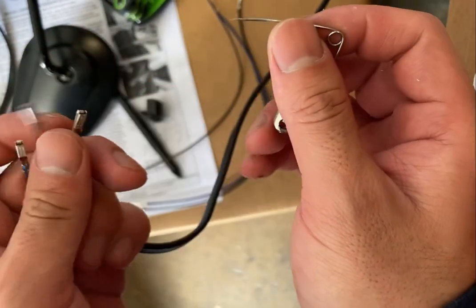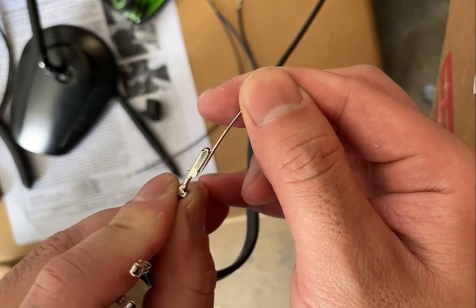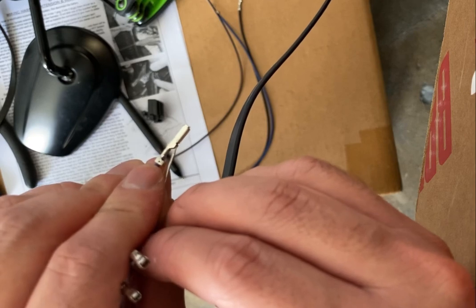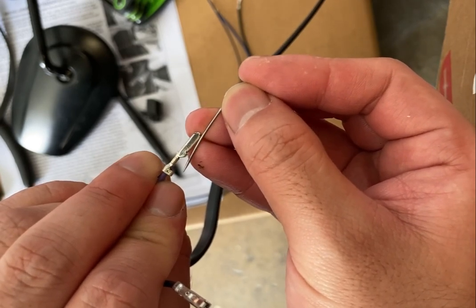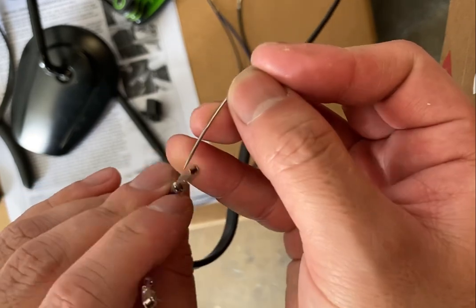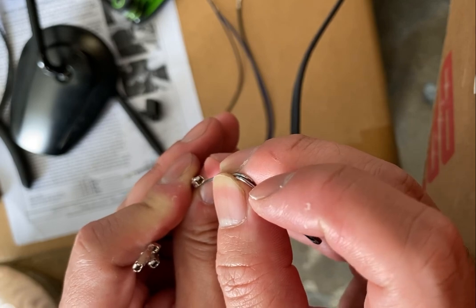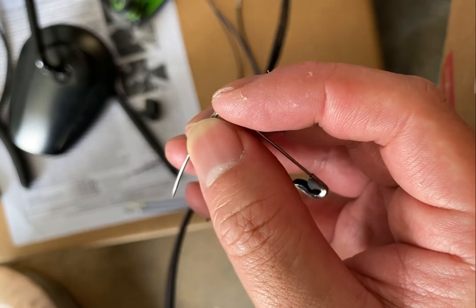Let me show you how it's going to be done on how it is inside. This pin is going to be like this — imagine this inside the connector. You're going to put the pin all the way right here, and there's going to be like a little safety lock right here that's holding it. It's like a little plastic tab. So what the pin does is if you put it right here, you hold that tab down and it frees up the connector. This is the metal divider — the connector. You're going to see this line in between, so you put it at the bottom, the bottom of that, put the pin like that, and then you push down and it frees up the line.